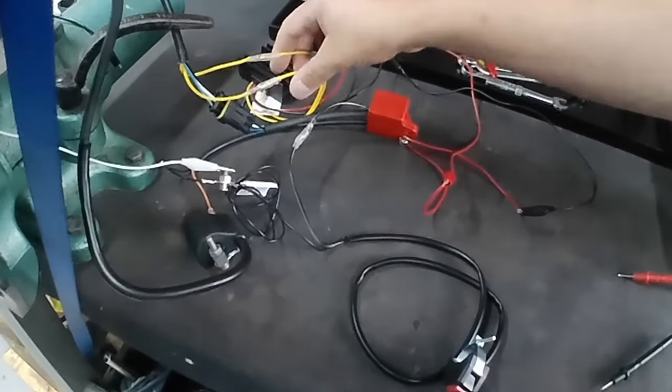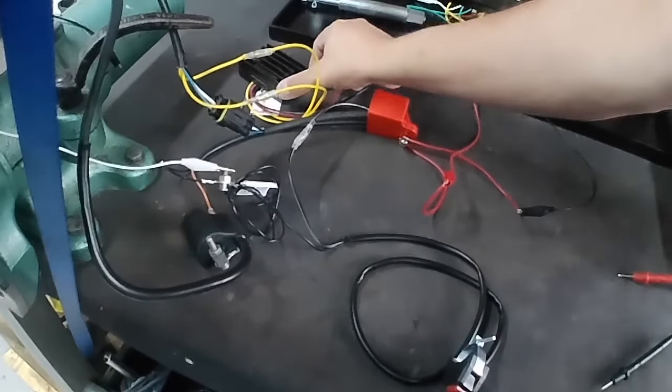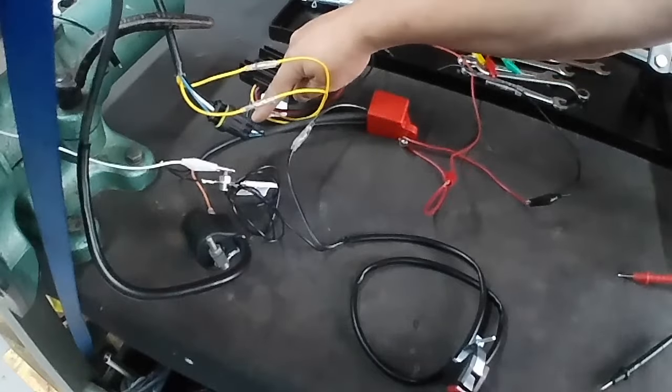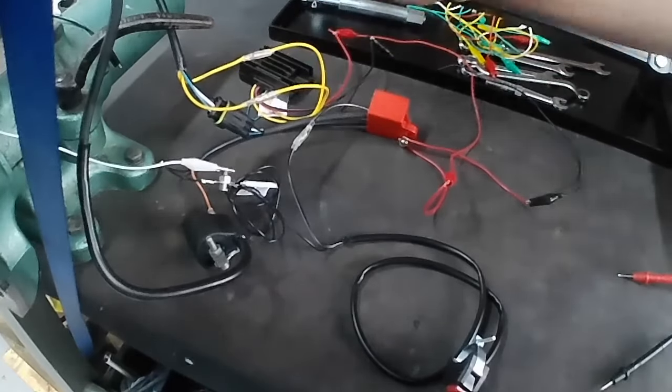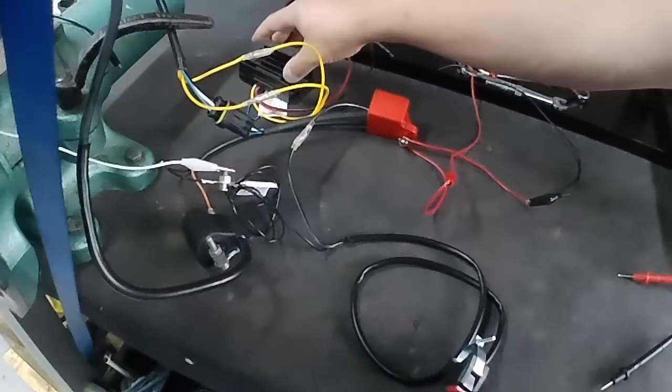We've got our yellow cables, AC current coming from our stator going to the reg rec, connected up. I haven't cut the cable. It's still at six on the 6 volt mode because I don't know what Peter's going to want to do. I'm guessing most people go 12 volts so they can fit LED bulbs, but I'm making no assumptions. It's his property, his decision.